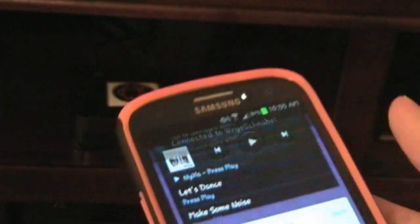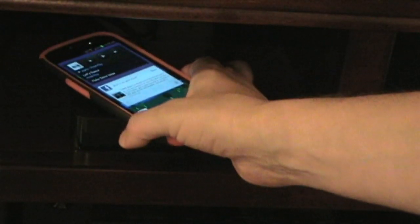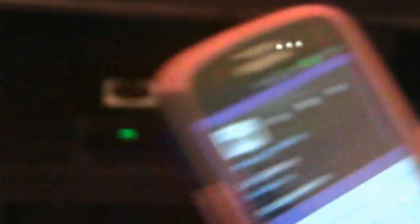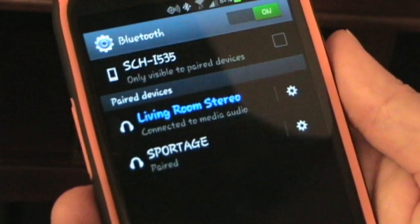Here's my phone — Bluetooth is off right now. The only thing you have to make sure of is that your phone's display is on, because if you tap the NFC tag while your phone is in standby mode it will not work — NFC is disabled when your phone's display is off. Just make sure your phone is on, then I'm going to tap that tag and it's going to do the rest — turn on Bluetooth and connect. You can see the little Bluetooth connected symbol, and the media receiver has turned green because it is connected.